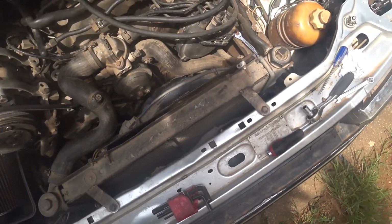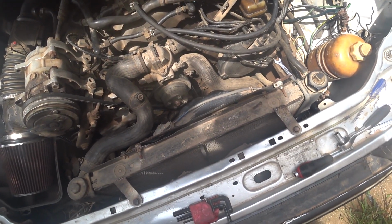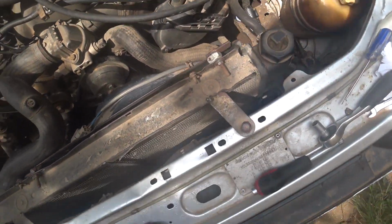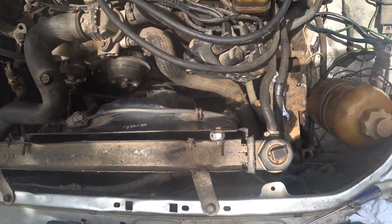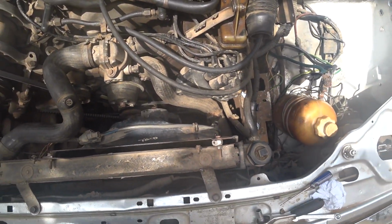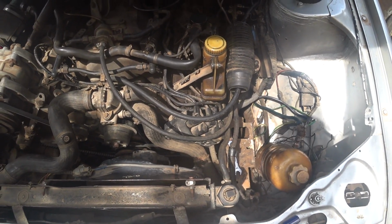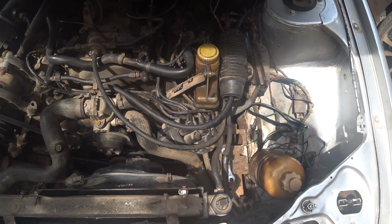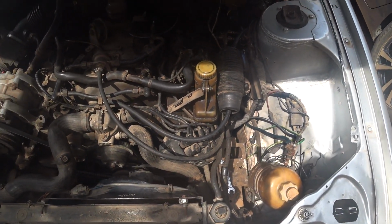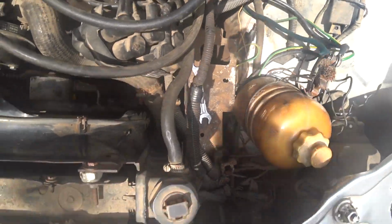Okay, so I'm done now. I've cleaned everything, mounted it back. So yeah, I'm going back to the harness. Now I know there's no problem here. At least it's good that I actually opened it. Those corrosion probably could be the cause. I could tell that once in a while it could behave as if there's a small misfire, then goes away. So maybe this will sort all those out. You never know how to start the car, but at least it's been ruled out.